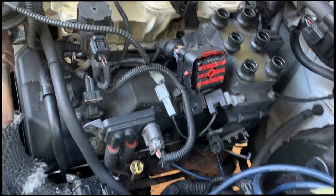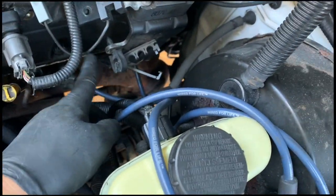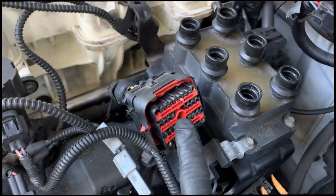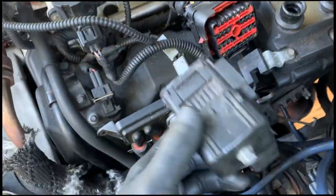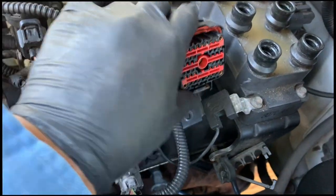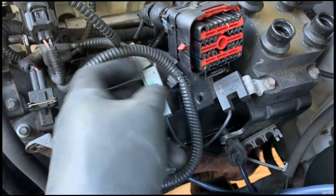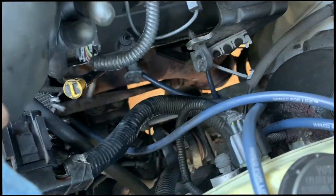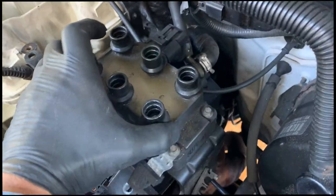Here's what I've done so far: I removed the two screws from the bottom — one was already missing. I removed one screw from the electrical harness. This big connector has just one screw right here — once I loosen this it comes right off, but you also need to remove the bottom screw to get it fully loose. Instead of fully removing it, I just opened it up and moved it out of the way. I removed the holder and now this is nice and loose.